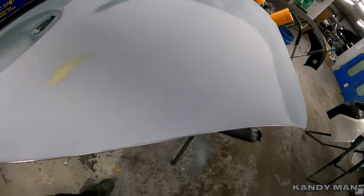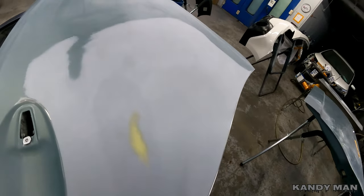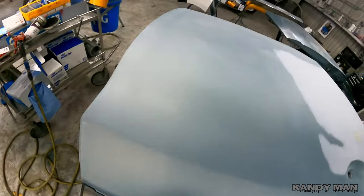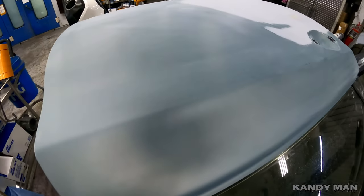We got that door fully prepped — the blend is 800'd, we did our body work and blocked it. We do have a little bit of putty or bondo showing through, but the sealer will catch that and we'll keep an eye on it when we seal it. We blocked it down until we got to the actual putty, so we know we went as far as we could to make it look straight. That's how I prep out my primer and my blends.